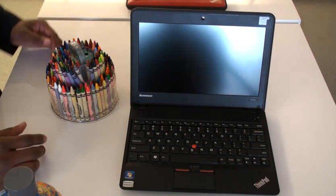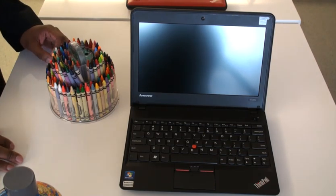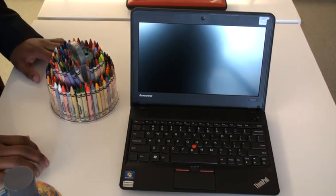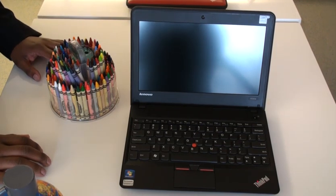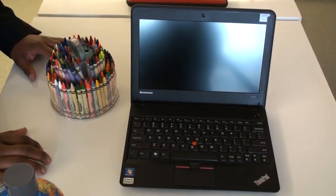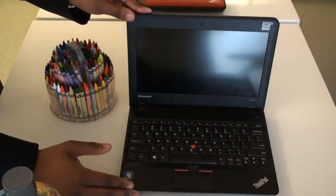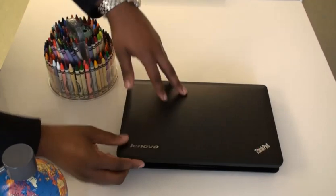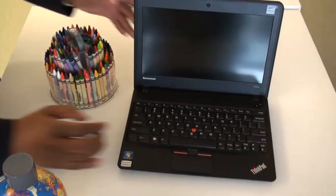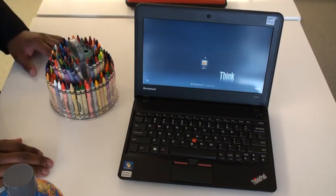Another thing is the mil specs, and we're all familiar with the 8 mil specs. How would you say, baked, burned? Yeah, baked, battered, and blistered, blown with dust. We freeze them, we bake them, we abuse ThinkPads. Yeah. Hot, cold, stress from hot to cold rapidly. Sure. Altitude, all of the standard 8 that we put our normal classic ThinkPads through. So we've done that, and we've added, like Kevin mentioned, the rubber bumper. We've actually added extra thickness to the bezel, so that we do not damage the LCD panel. So we've done a whole lot of research to make sure we've knocked out those issues.